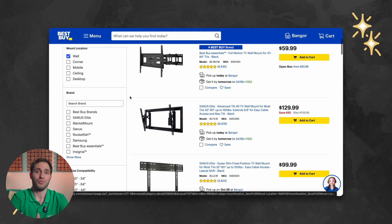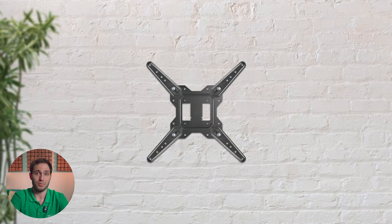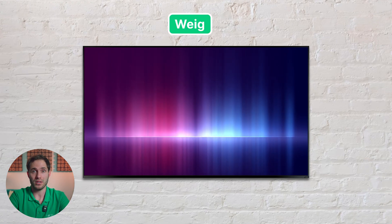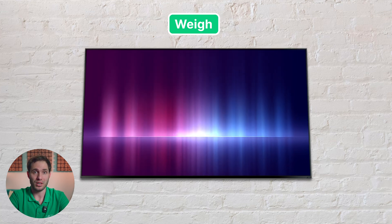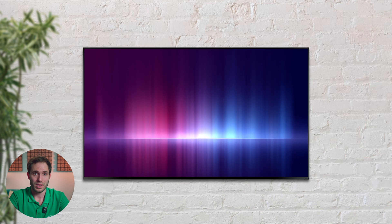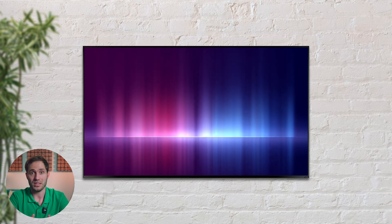Our display needs to be attached to something, so we choose the mount accordingly. There are three main types: floor, ceiling, and wall — the last two being the most common, and more likely these will be VESA standard mounts. When choosing them, the mount must be designed for the weight of your TV and fit its established mount dimensions, for example 200x200 or 400x400. It is extremely important to take into account the material and strength of the wall or ceiling to which you are attaching your TV. Finally, for wall mounts, pay attention to the distance from the wall to the TV — try to avoid mounts with an extension of more than 10 centimeters, for both static and safety reasons.